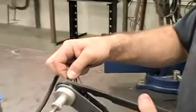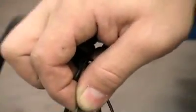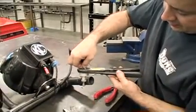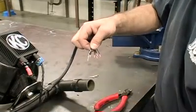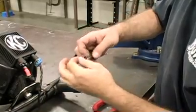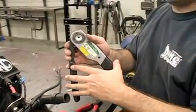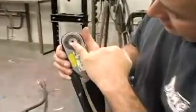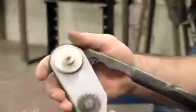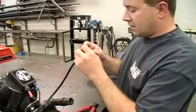Okay, I just slid the pin over two of the grounds. Now I'm going to put them into the crimper. It just slips into the crimper. It indents it on all 4 sides. It still maintains its roundness. And the crimper, I don't know if you can pan in on this, but as the crimper goes, you have the indents that come in there and squeeze the connector, which is adjustable by wire size and depth. We'll move on to another pair here.